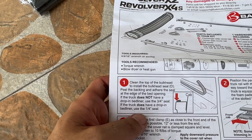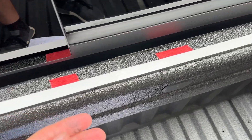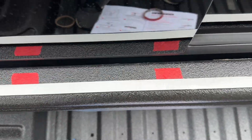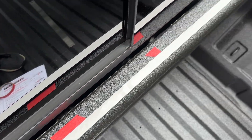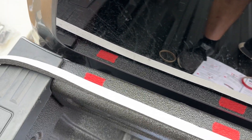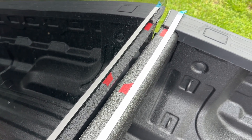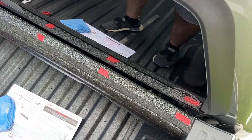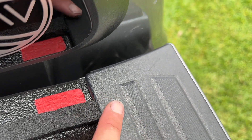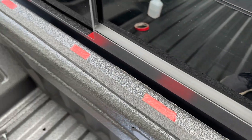The first step is going to be to clean the bulkhead so we can put the seal down. They want you to put this seal as close to the bedside as possible. I went ahead and did some measurements using tape to get this seal as straight as I can — if I can get it nice and perfect, I will. I did cut extra past here so that I can compress it so it's pushing against the rails, to try to get maximum sealage there.